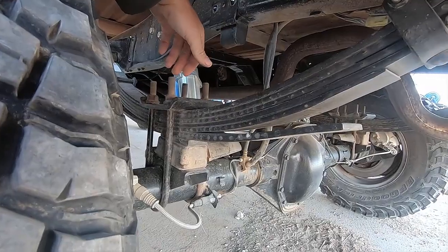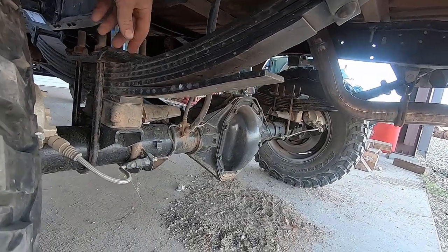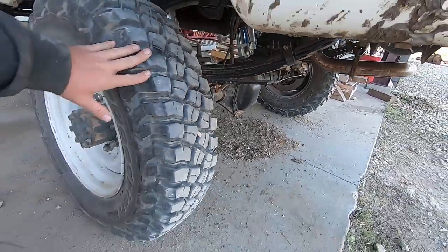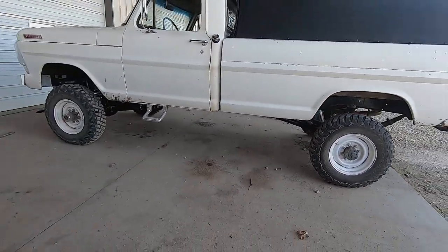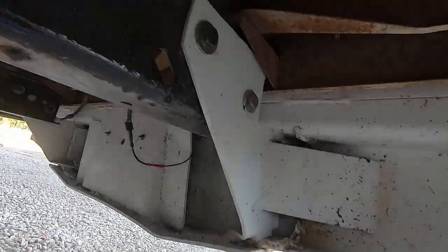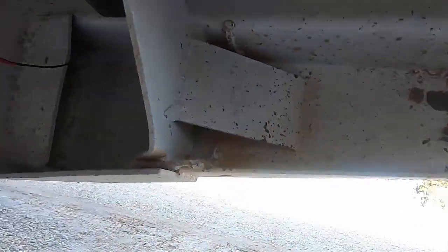If you remember, I had to move the axle forward to make the wheelbase right for this '67 model truck, because this is a '73 frame — two inches longer wheelbase. I'm probably not even going to touch the bump stops, so it's no big deal; it's still plenty strong. That made it sit a lot more level. Here you can see how I mounted the bumper. Here's that plate I had to cut off originally — it's welded on. I added a little plate here for strength, and I had to stick the bumper out just a little bit further.